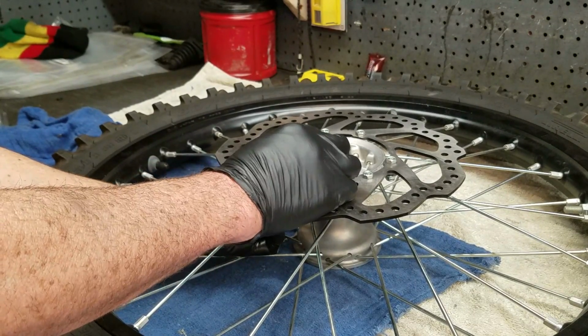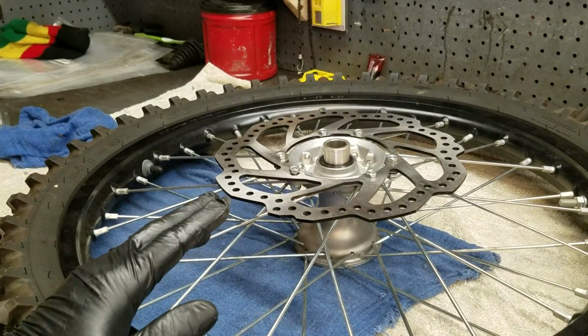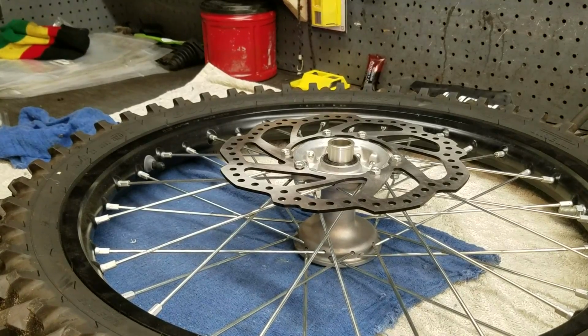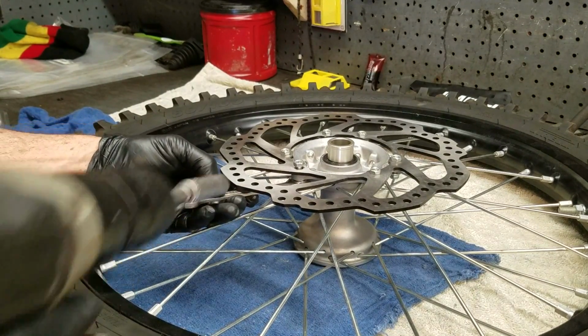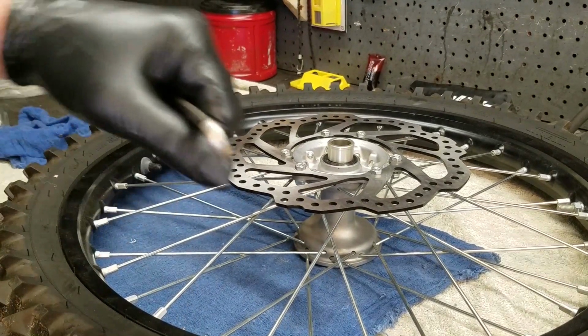Come back, check all your fluids, coolant, and motor oil. Let it cool down for about 15 minutes, and then do the same thing. Another shorter ride, 8 to 10 minutes long, except this time on your second ride, you can do a little bit of full throttle here and there. Nothing long at all. Keep it short, just short bursts.